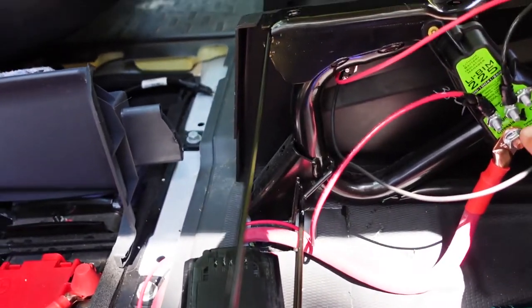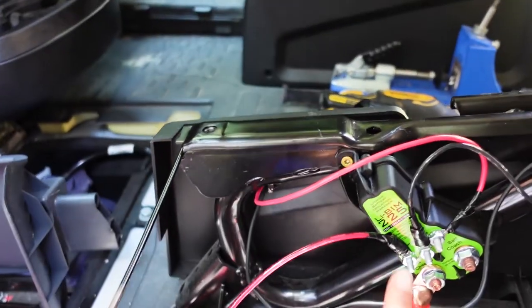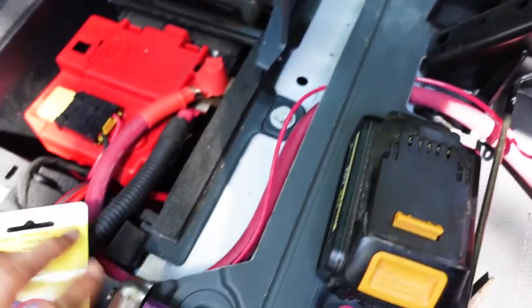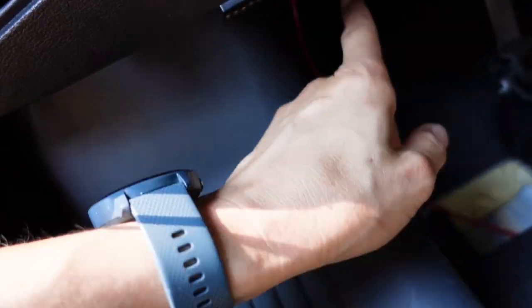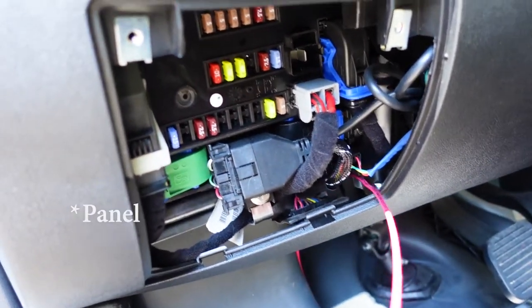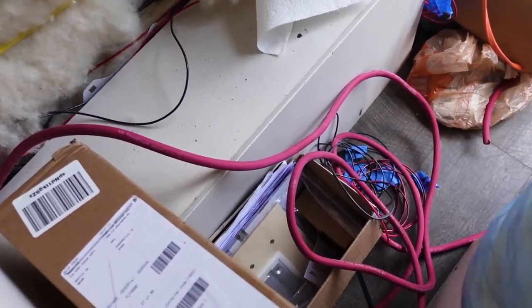For the fuse tap wire that gets placed on the ignition spot on the BIM — which is a battery isolator manager — we're running that wire, fishing it through here and up. There's this piece that goes back here and covers everything up; I've removed that to run it all the way underneath so you don't see any exposed wires, and out through there and up to our fuse circuit board. Now we're all tied into the coach terminal, and that runs behind the seat down inside of this step we made, under the van, and then back up into the van where our battery bank and distribution center will reside.